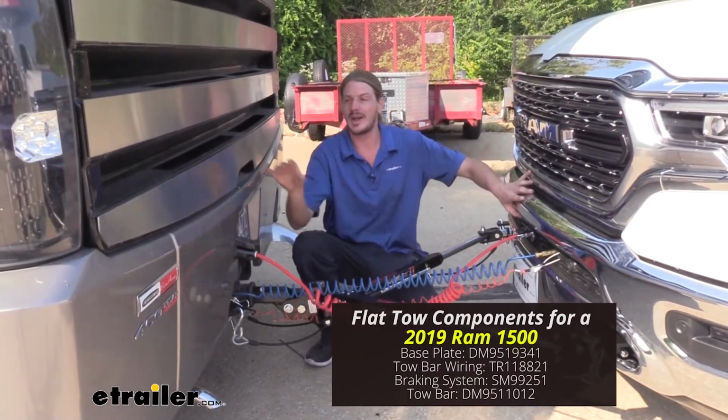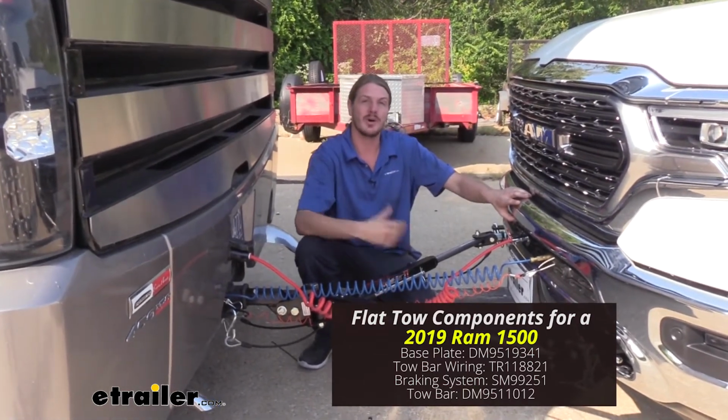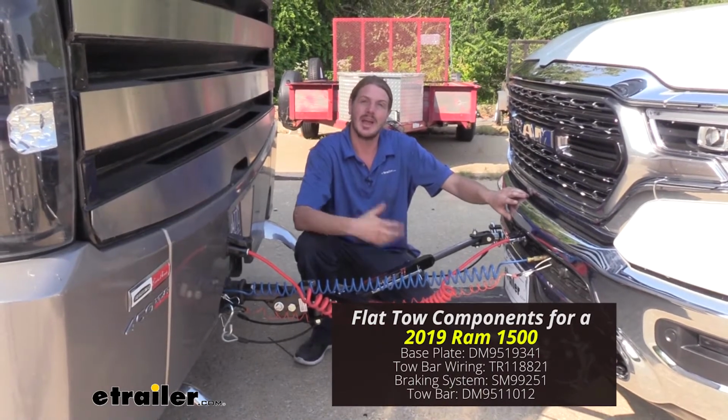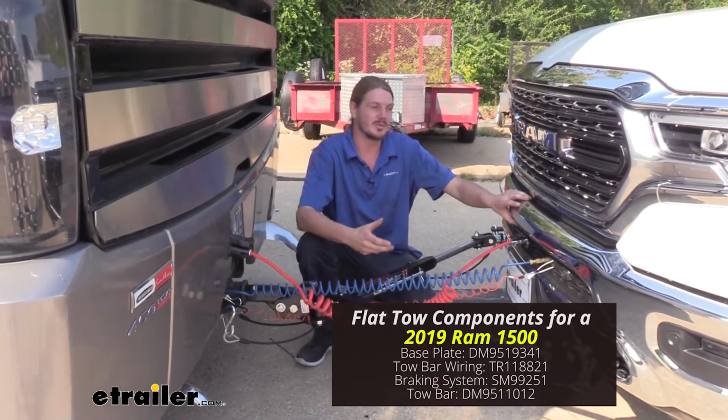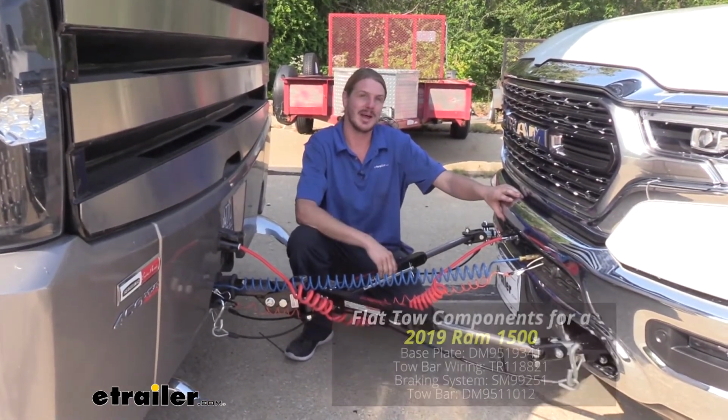your diode wiring, which takes all the lights from your motorhome, transfers those signals to the back of your vehicle so all those lights will work properly so people behind you know your intentions when going down the road, and your supplemental braking system, which will apply the brakes in your vehicle when you hit the brakes in your motorhome to help it come to a safe stop.